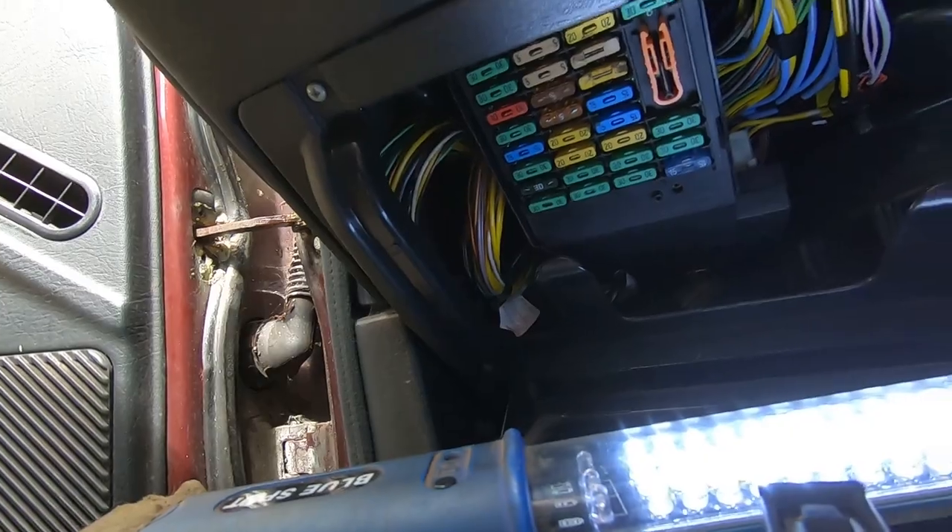It's a bit of a bust with the fuses - 9 and 32 were okay. Next up, just going to try putting some actual water in it, just in case it's the quietest motor in the world and it just needs water. I know it's probably not going to work, but we'll pop it in. If not, we'll jack it up, get the wheel arch off, check the motor and the connections, and if not maybe the motor's dead.